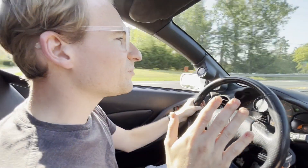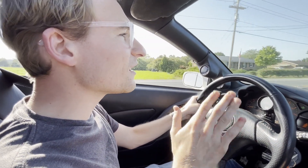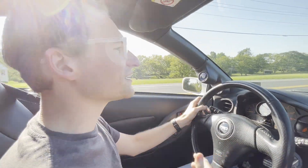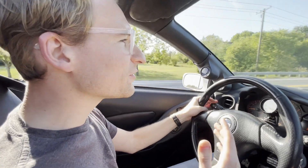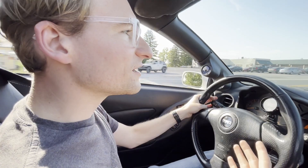The main problem without a bypass valve is whenever I'm actually applying the throttle — without the clutch engaged, it's pulling air through the rotors of the compressor, which isn't being turned yet because the clutch is off. So in the low revs, like if you're at a stop sign coming off the clutch, it's laggy. You've got to give it a lot of throttle to pull air through those rotors. With the bypass valve fully recirculating, it sets a low enough pressure that it helps, because some of that air is able to pass through the bypass on the intake stroke rather than all being forced through the supercharger rotors when the clutch is off.